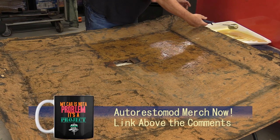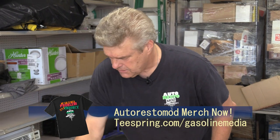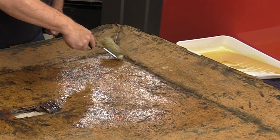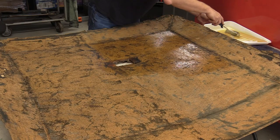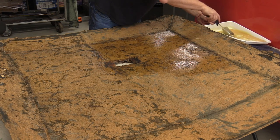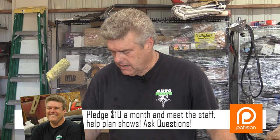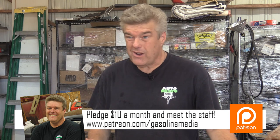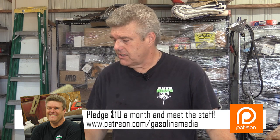This is going to be pretty boring to watch so I'll do most of it off camera, but you want to get a good coat everywhere, especially down in the creases. Those creases are pretty important for a Ford headliner to look correct. Also, please be sure you're in a well-ventilated area — contact cement, the great caramel of death, will get you high and hurt you. You will end up with a bad headache or worse. It's very loud on the nose.